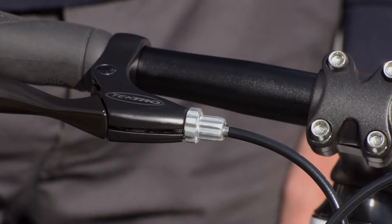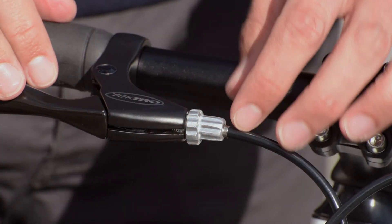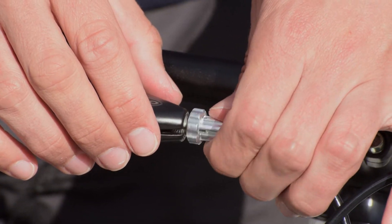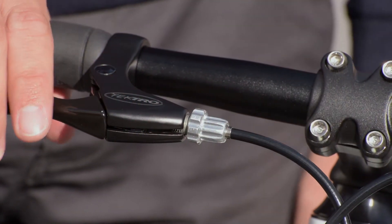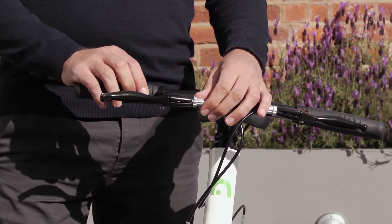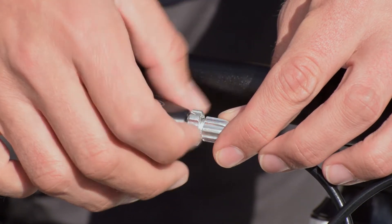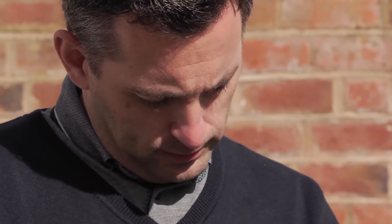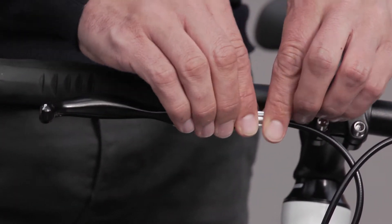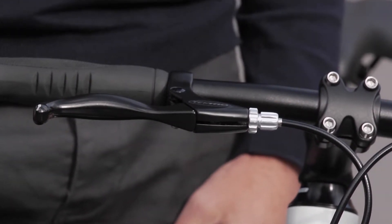There's a ring and a bolt where the brake cable enters the lever. Unscrew the adjuster ring by turning it anti-clockwise, then unscrew the adjust bolt by a few turns. This will reduce the travel in the lever. Test it to make sure it no longer pulls all the way back to the handlebars. Hold the bolt in place with one hand while tightening the ring with the other, and make sure it's nice and secure against the lever mount. To keep the slots in the bolt and ring free of water and dirt, make sure they are not facing upwards or forwards.